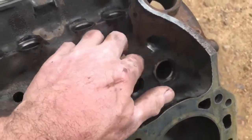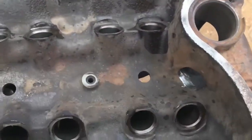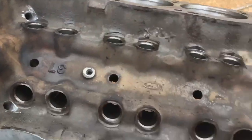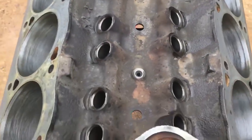I cleaned up this hole here that the oil flows through. Maybe it'll flow a little easier and fall down onto the timing chain and help lubricate it. I also radiused out these return holes back here. Oil laying up here in this area isn't going to do me any good — it needs to go down back to the pump and come back up through.